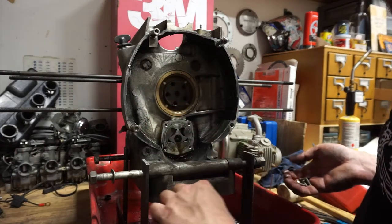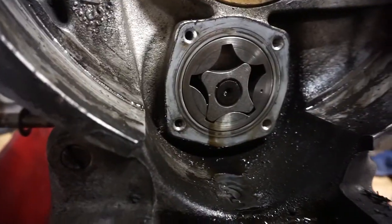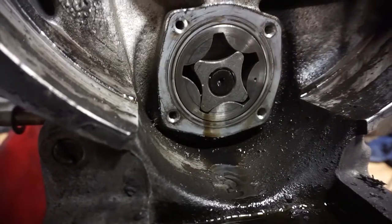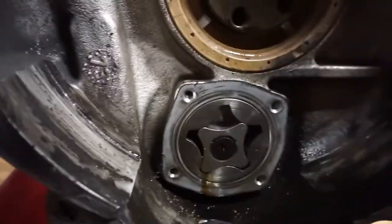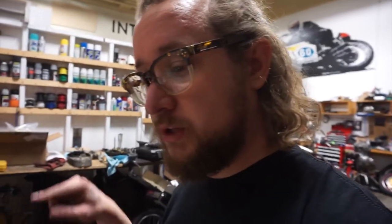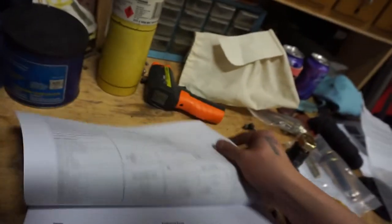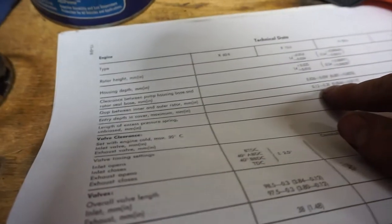There's the oil pump. So the oil pump looks pretty okay, I can see some scoring and stuff, but the surfaces that I can see look all right. But I'm going to take measurements and actually confirm whether or not that oil pump is still good. I am replacing it regardless, but considering what the connecting rod bearings look like, I have a feeling that that's probably out of spec. So we look in our BMW shop manual for the numbers that we need